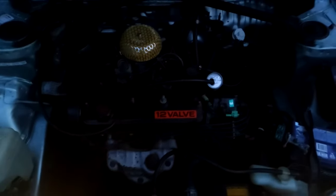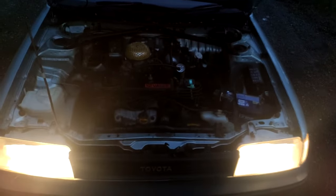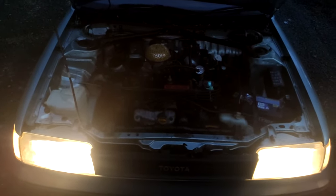This is what the motor sounds like now after I've changed all the spark plugs, cleaned the fuel filter, cleaned the carburetor and all the fuel bowls, and all the jets. It's been perfect — nothing wrong with it, no rough running, nothing like that. It had a slight little shake beforehand, but after I've done all this, now it's all sweet. Just about having the wrong type of fuel and all that sort of stuff, and it runs perfect.